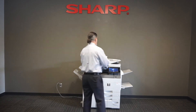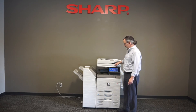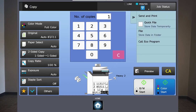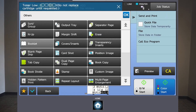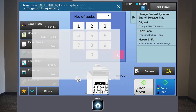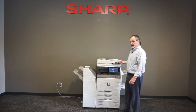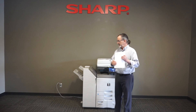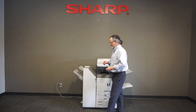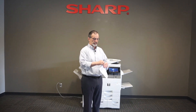If this is a little bigger pamphlet than you like, I can run through the same job. I'm going to go back to the home screen and start over. I go into copy mode, under Others I select Booklet, left binding, one-sided originals. But in this instance, I'm going to tap on the drawers and tell it to put it on eight and a half by 11 paper, and then hit the auto image button. I'm using the same eight and a half by 11 originals, but I want to make a five and a half by eight and a half pamphlet, so the machine itself shrinks it down and knows the correct size.